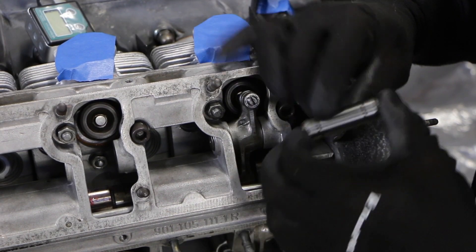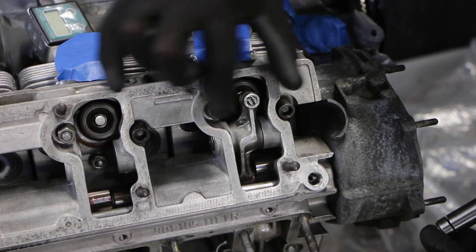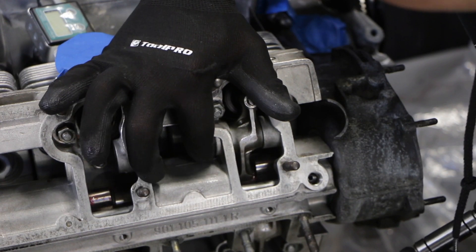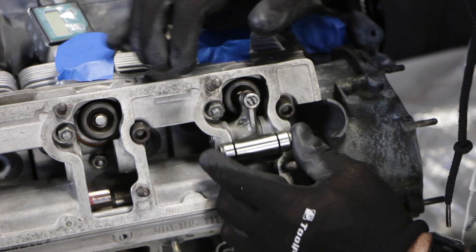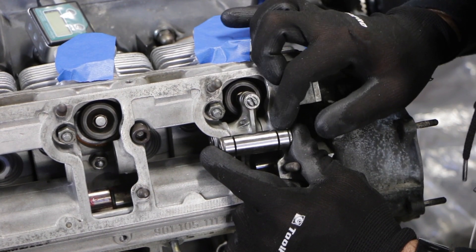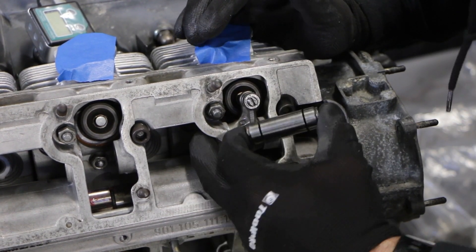A note with these rocker shafts: you've got a narrow side of where the rocker is and there's a broader side on the other side. You want the rocker shaft — the end of the shaft itself — level with the end of the housing. You can hold up another shaft here and actually see where you want to have the RSR seals. You want them obviously to be well and truly inside the housing, so that's just something to make note of when you're tightening this down.